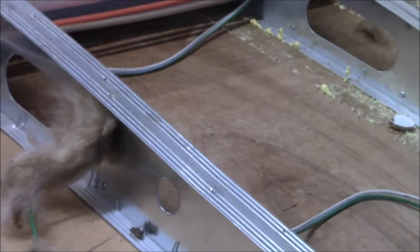What we did on the fix of these is these wires running over. I took a piece of aluminum, we just bent it over, taped the aluminum down, then we taped these to the wires. We want to make sure it's not going to chafe into the ductwork, once all this happens after you put the roof on.